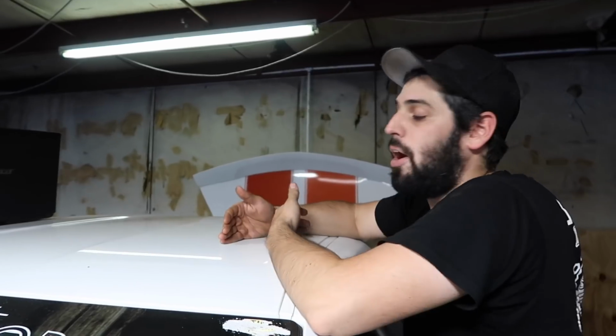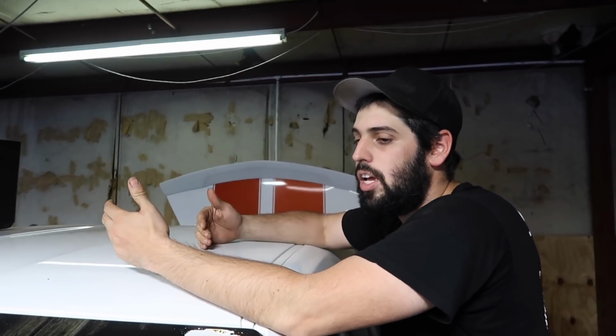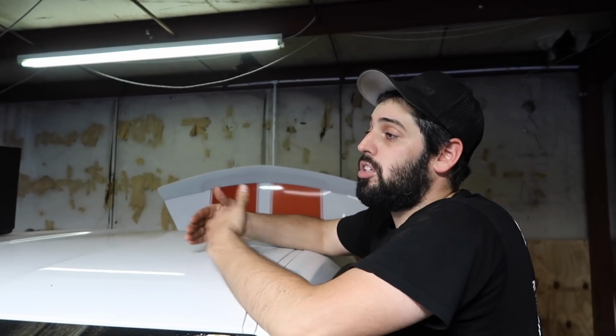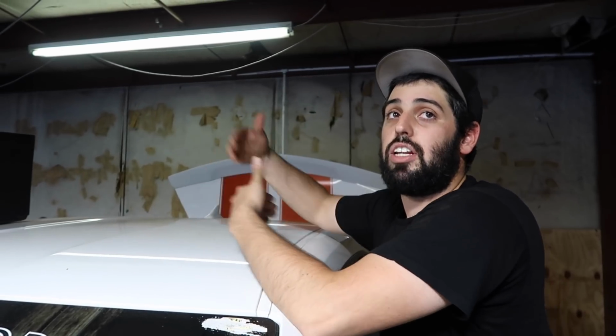So I literally had a note in my phone that said what pound of boost made what horsepower, just to give me a basis of what to go off of. That's not the right number, and it's off. I mentioned it earlier in the video, 10 pounds on the dome was making what 12 would, and it was gravitating as it went up.